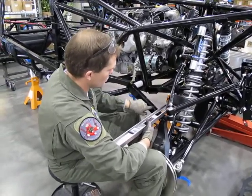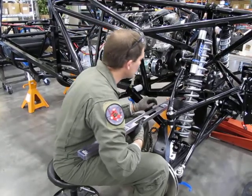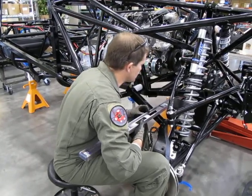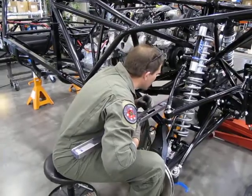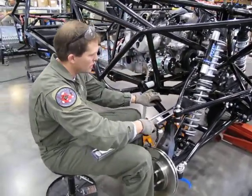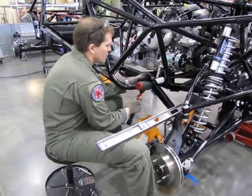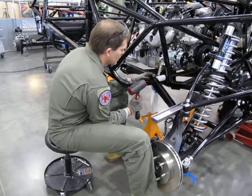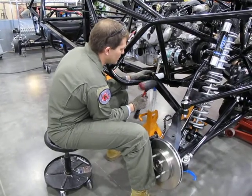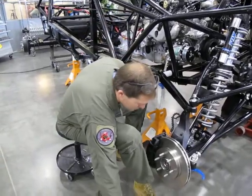So you'll see when you look here, 1, 2, 3 holes down and about 1/4 inch down, I place this, and I'm looking across and I can see he's about 1/4 inch down on the third hole, and then we look at the bubble on here and the bubble says level, and that tells me that our sway bar is indexed. Then you pull out the level and you take your dead blow hammer. You want to pull the level out from that side? Thank you.